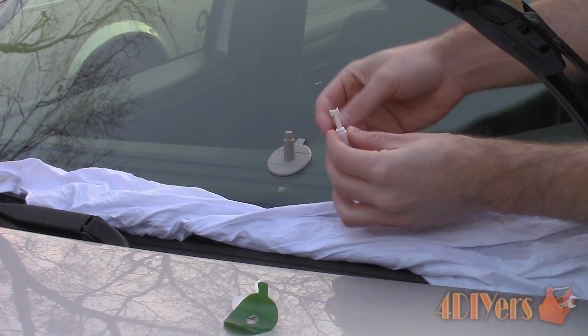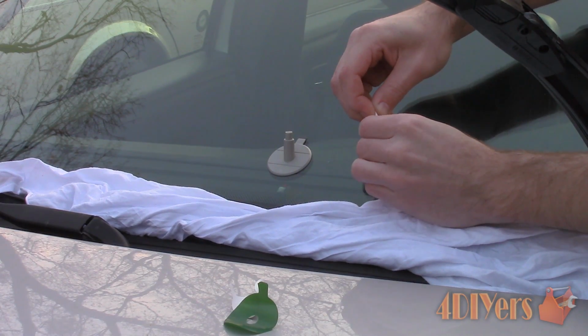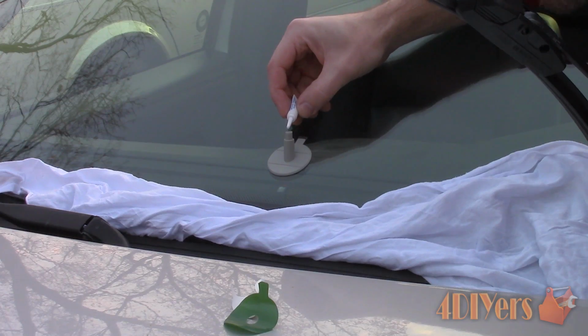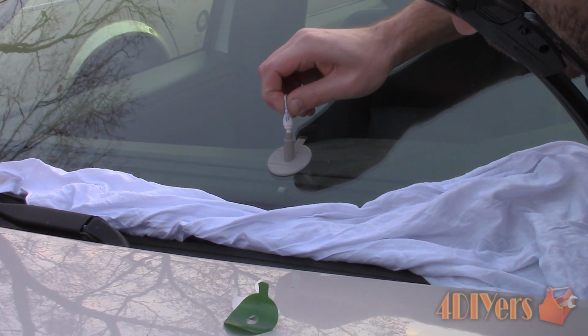Take the resin container, either cut or twist the end off, then apply 3/4 of the resin container into the pedestal and put the resin container in a safe location where we won't drip it on anything. We will be using the remainder of the resin afterwards.